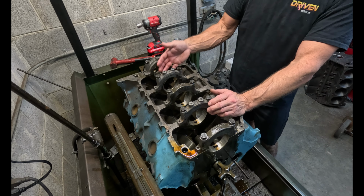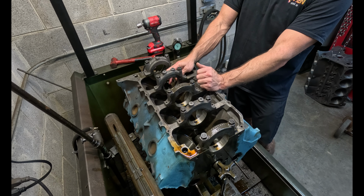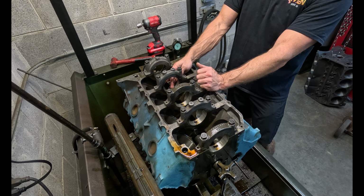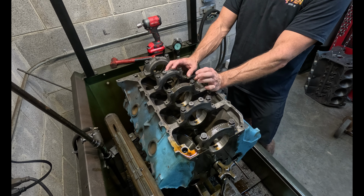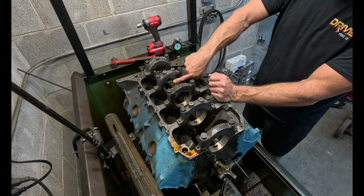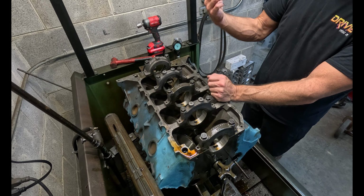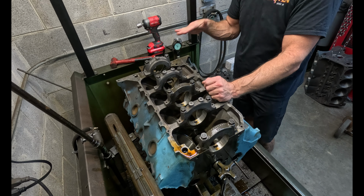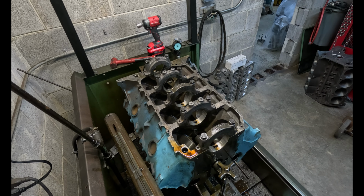So obviously the block was down or up here also for that to work out that way, because from the parting line to the inside, every one of these caps were the same height when I cut them. Even the second time, they were still all the same height. So I'm gonna just trim that one a couple more thousandths.